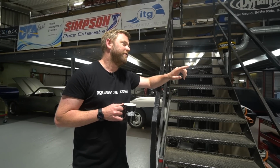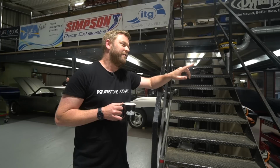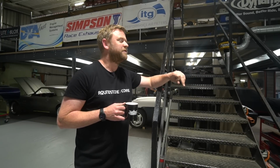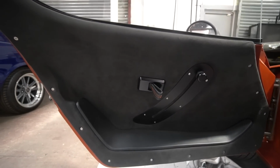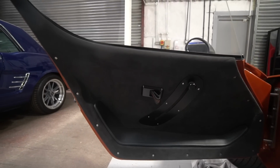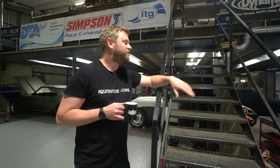And we swapped out the screws. The door panels are screwed to the door outer, and it was originally just with stainless self-tappers, but some of those were starting to get a little bit iffy on the threads in the fiberglass, so we've swapped all those out for riv nuts and got some nice little stainless wafer head bolts to do a neater job of fitting the door panels in. And I think we are getting extremely close.